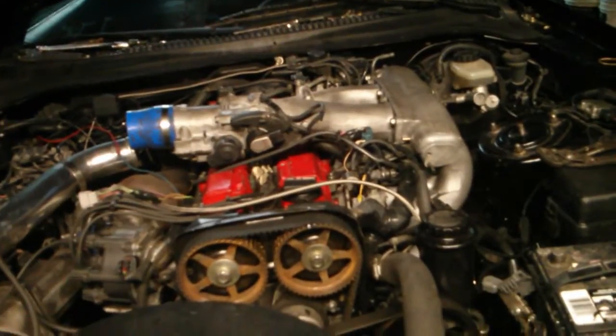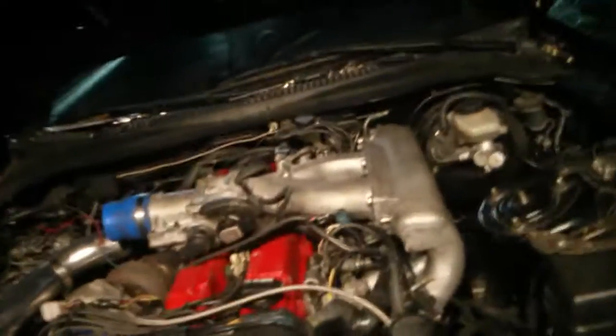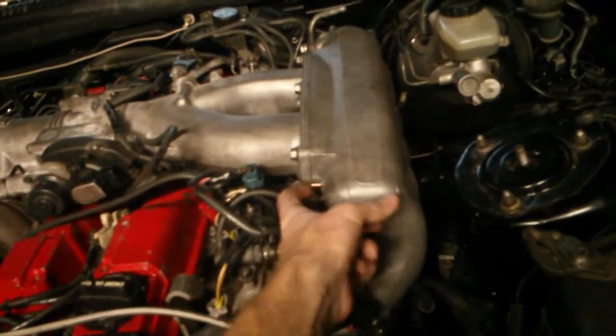This one still has a six-speed transmission — not the really expensive aftermarket one, something like $7,000-$9,000 that you'll find on eBay if you search 'Supra transmission.' When running a turbo on a non-turbo car, you need to figure out MAP sensor placement. Plug it into the same spot Toyota originally placed it — they put it there for a reason. If you put it near the fuel pressure regulator on one end, it's going to read a different pressure than if it's in the middle. Put it right in the middle where it gets an accurate pressure reading.